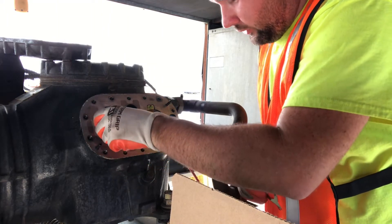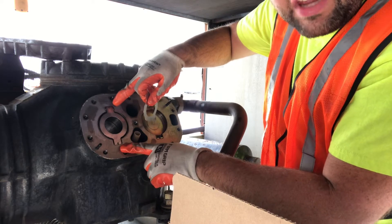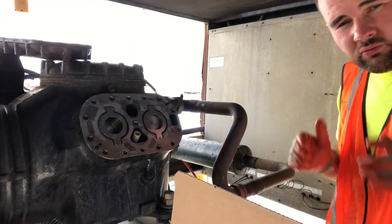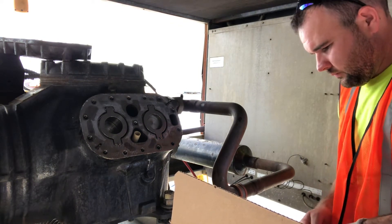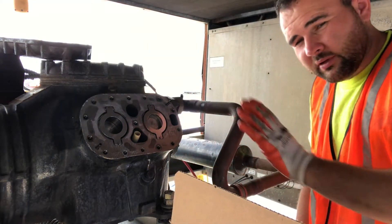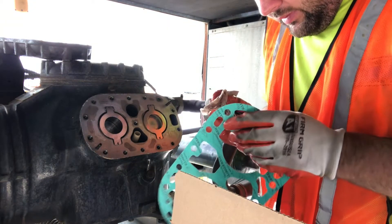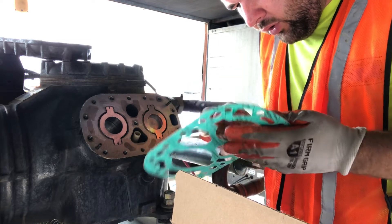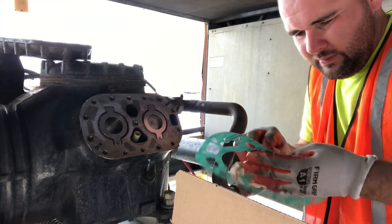Got our new — I'm gonna call these our suction valves or suction plates. There are little tabs they just sit on right there. Put them in place. Looks like they're symmetrical, identical — there's no correct way to orientate them, it's just universal. They did give me new pins in case these came out, but I'm gonna leave the existing ones since they don't budge. I'm gonna put a little oil on this gasket — good general practice, just get a good light layer of refrigeration oil all over it to make it wet. It's gonna seal up much better if you do that.